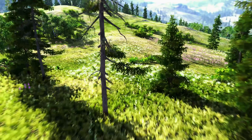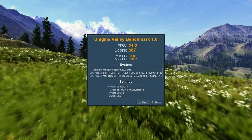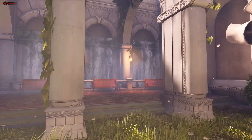Opening up the benchmarks, running the card at 1000 MHz. We started off with Valley at 4K — the average wasn't so great, probably because of all the filters and anti-aliasing we had turned on, which really killed it. At 1080p, no problem at all. I did hear a little coil whine, mainly in the menu where it was running at like 2000 FPS. Once I got over about 100 FPS I noticed a slight hum on the test bench — put it in a case and you probably won't hear it, but I want you guys to know I heard some coil whine at high FPS.